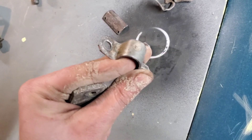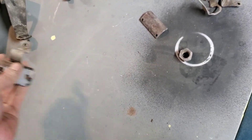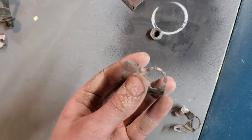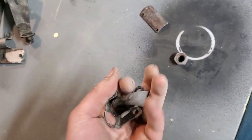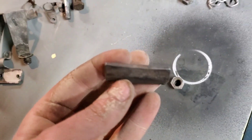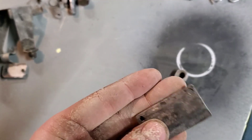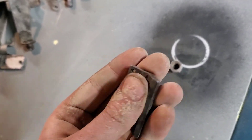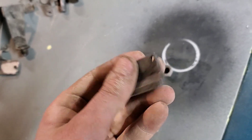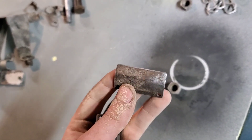Parts like these I'd say are ready for paint after being in there for about an hour. These are some little brake fitting clamps — these are usable. This is a sliding wedge piece off of a Fiat brake caliper. So it took the surface corrosion off and it's pretty smooth now — I'd say that's usable. There's another one; this one's a little bit more corroded, might want to replace this one.